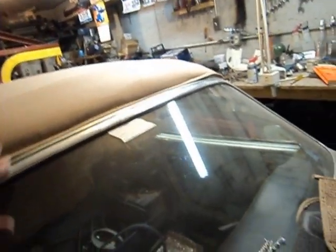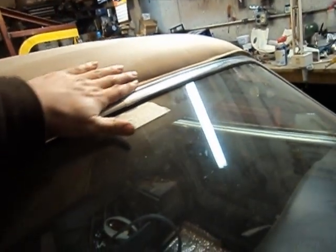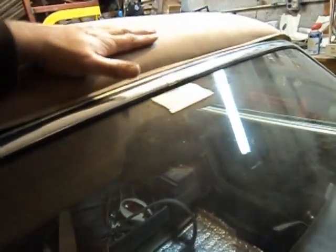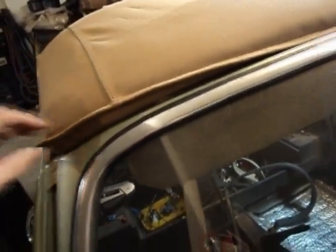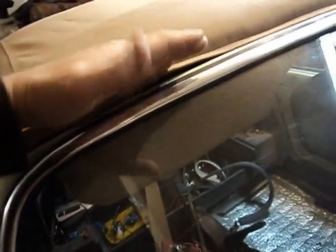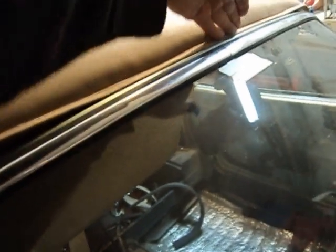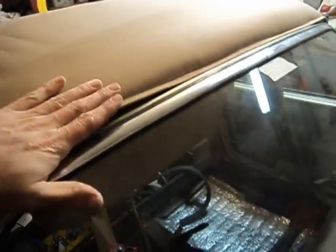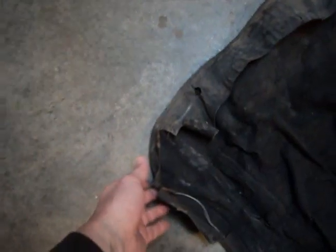Just closed the top down — you can see I've got some straightening out of the foam to do, we're seeing a little wrinkle in there, but not a big deal. I can fold it back and put my hand in there to straighten it out. You can see how this seam follows the windshield — the last staple I put in was right here. As you work this top, that's exactly what you want: this sucker to just lay down perfect on the windshield frame, and once that's done you can staple it off.